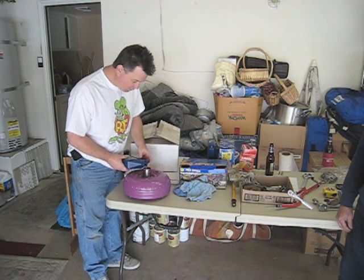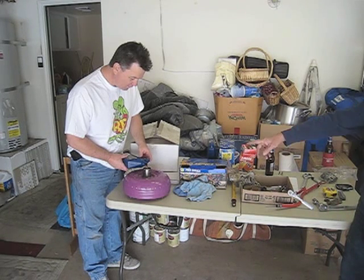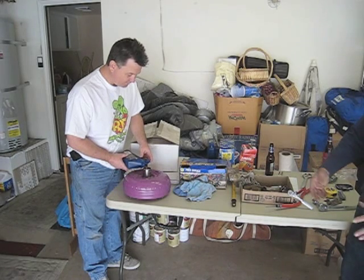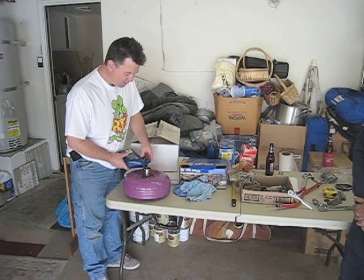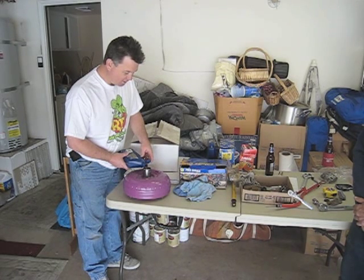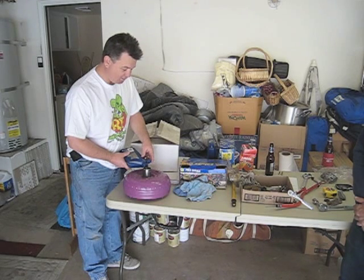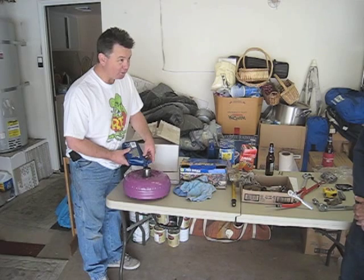Okay. So we're just going to put 1 quart in? 1 quart should be enough. We don't want to overfill it, otherwise the fluid will start spilling out of it as we handle the thing. Okay, now it probably holds 2 quarts. Some articles said that the late 60s versions of these took type F fluid. Right.